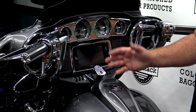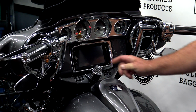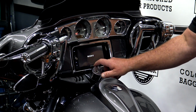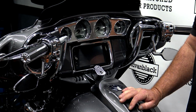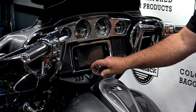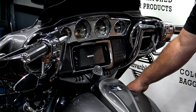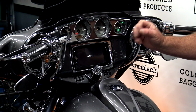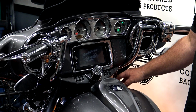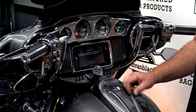Once you've let it run and you think, okay, it's probably synced now, go ahead and turn the bike back on. You're going to turn your hazards off, turn the bike back off, just like that, and then it should be reset. Then you can turn the bike back on and hit your blinker. If your dash is flashing with your blinker the same speed, you have synced your LEDs. If your blinker is blinking normally and your dash is still hyper flashing, go ahead and repeat the process.